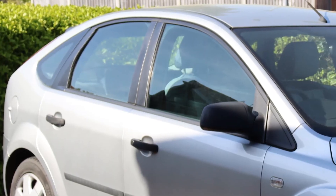Okay, that's the basics, but keep watching because there are a few more things you need to know. All we've done in this video is set the child lock on the left rear door of this Ford Focus. Nothing we've done has affected the right rear door. That lock has to be configured individually, but it works in reverse. So, for example, rather than twist the ignition key anti-clockwise to engage the child lock, twist it clockwise instead.